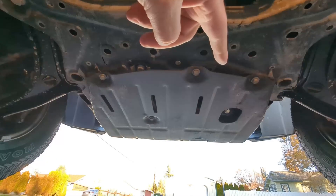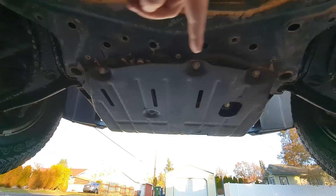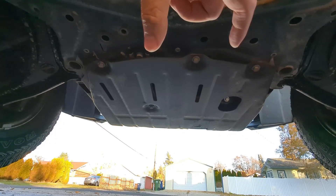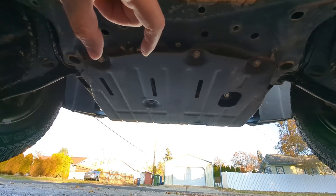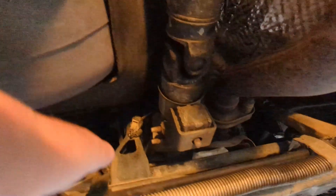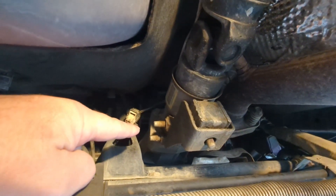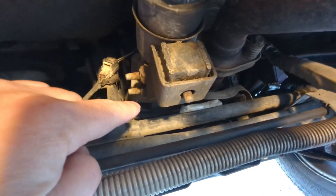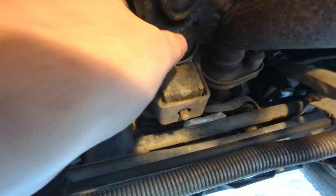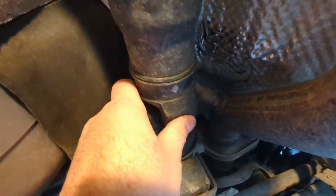Let's get back to the hardware. The engine and transmission on a Jeep Patriot are mounted transversely — that means there's a little four-cylinder engine mounted side to side, and then a little skinny pancake transmission kind of on the side of it. But what not everyone knows is that there's also something called the PTU — power transfer unit. The PTU is in constant mesh with the front differential carrier, and whenever the front wheels are rotating, the PTU is turning and the front driveshaft is turning.